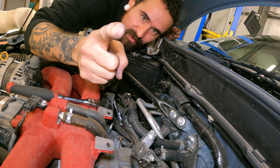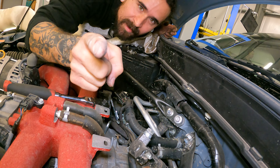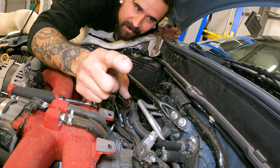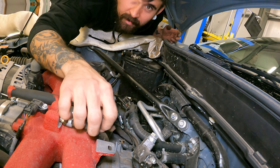There's one thing I always forget until I see the power wire on the starter — disconnect the battery. Don't forget to do that, otherwise there's going to be sparks everywhere, melting, and your car might light on fire.